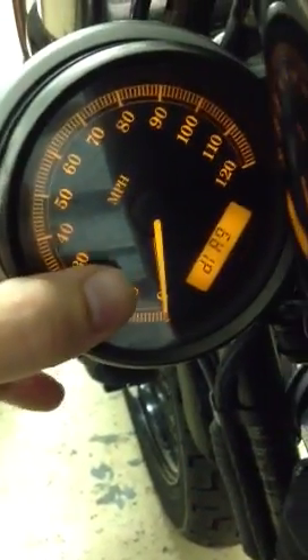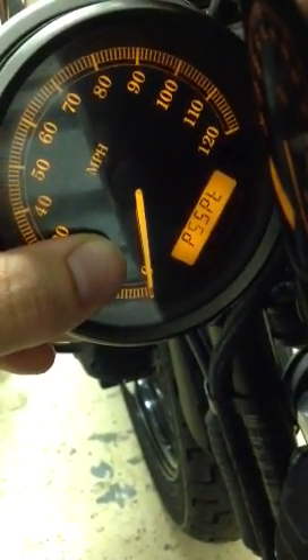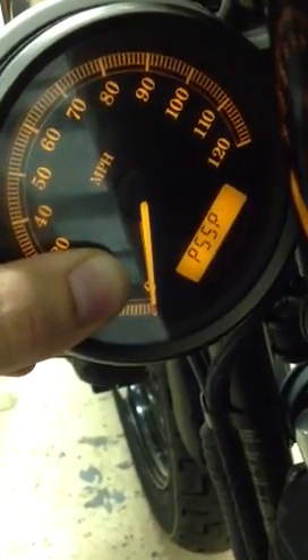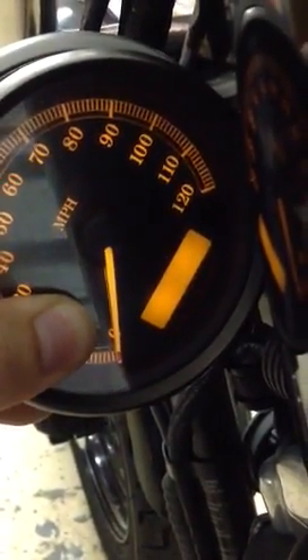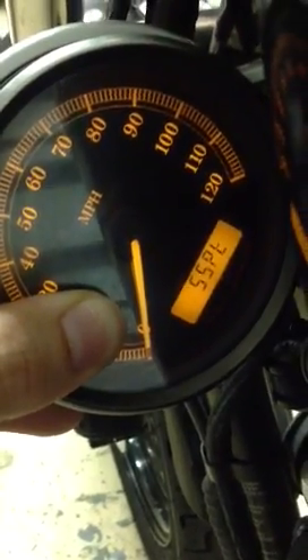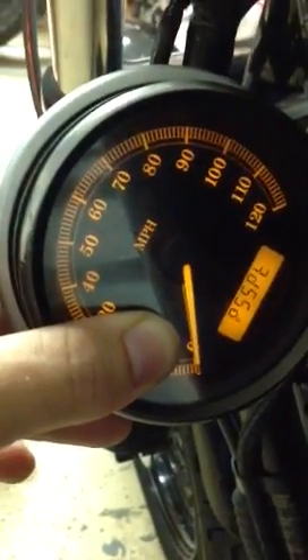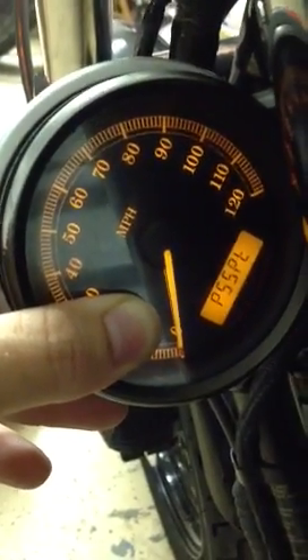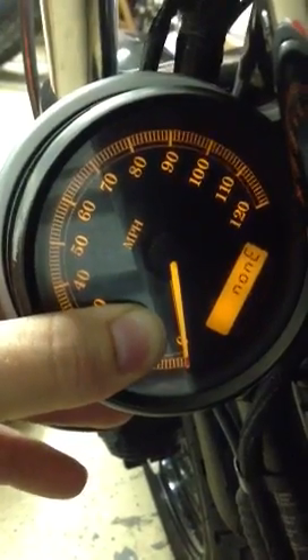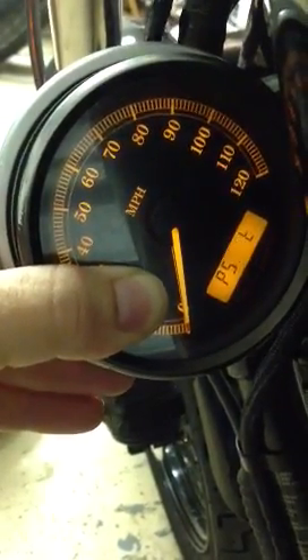What it does is it notifies your system that you want to go into diagnostic mode. You'll know that you're successfully in there because it says 'Diag' on there. Basically you're just going to use the button to navigate through all the features: P being the electronic control module, S for the turn signal security codes, SP being speedometer, and T for tachometer for those of us who have the RPM gauge. I don't have one, so when I select it it'll say 'no response.' For the other ones, let's say theoretically my check engine light came on — I'm going to cycle through each one and check them for any codes.